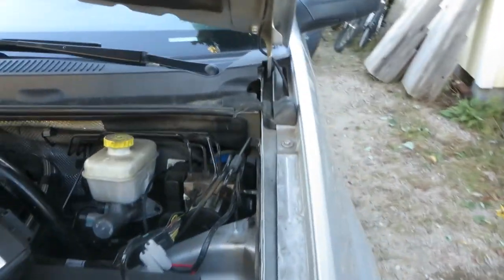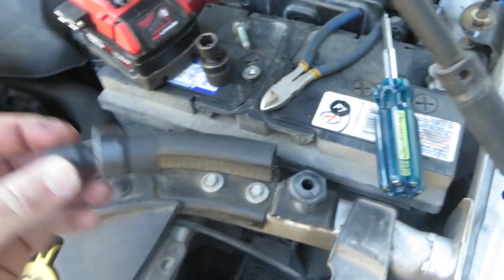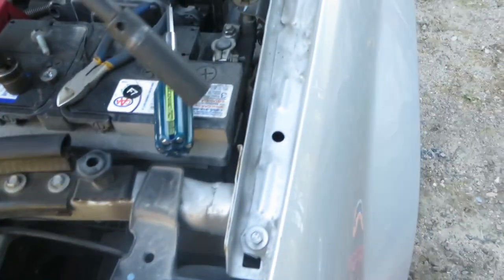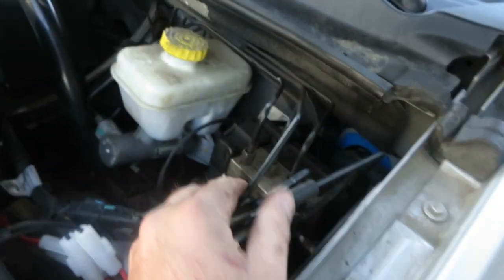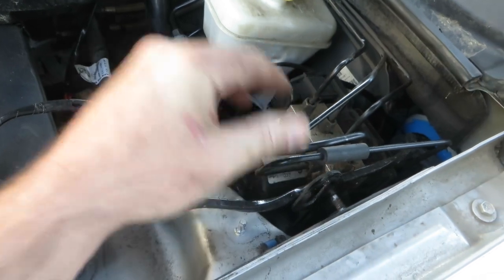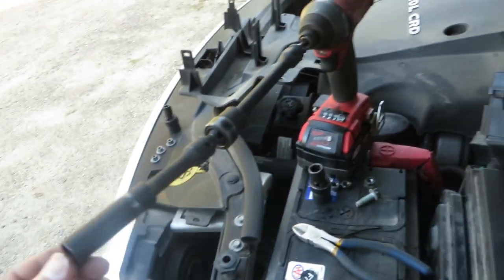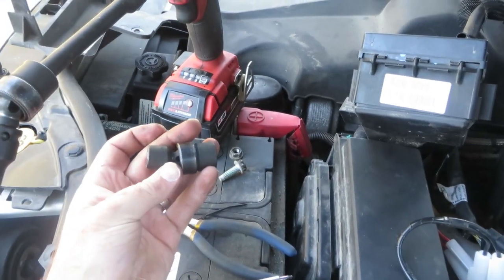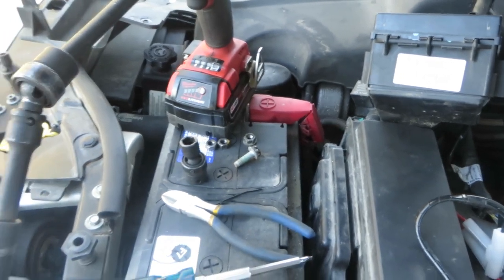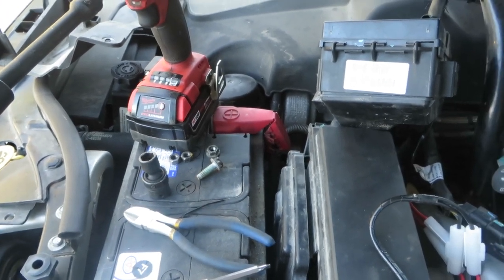After working on this for about 10 minutes: you remove the electrical boxes, take out the tray - there are three 10-millimeter bolts to do that - and I used a swivel to get to them. Then there's a 13-millimeter bolt holding the ABS box in, and I used a swivel again for that. The master cylinder also ended up being 13 millimeters, so it's 10 and 13 millimeter fasteners throughout.